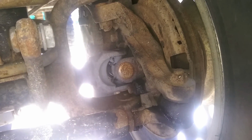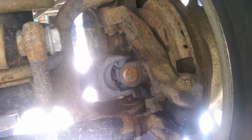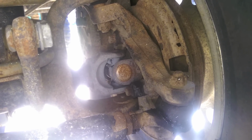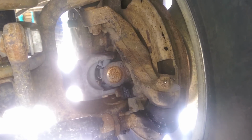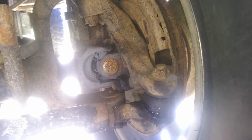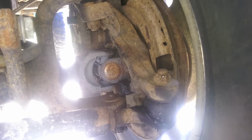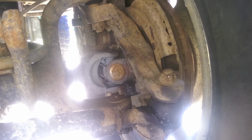If you've ever done some hardcore wheeling on big tires, you know that these U-joint caps like to wiggle free after running around for a while. So I put in some full ring clips, I clearanced them out, and they seem to be holding up. I took them on a trip and drove it around, and they don't really seem like they're breaking free, so that's good. They did work, and the axle shafts didn't snap.